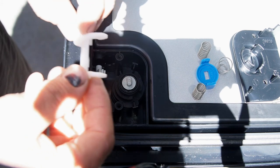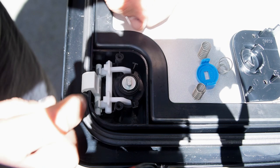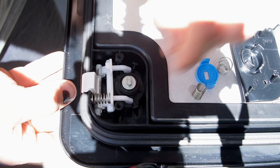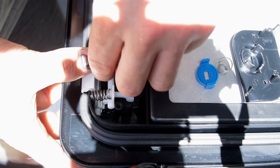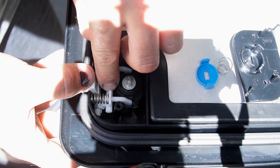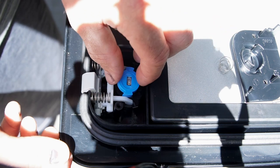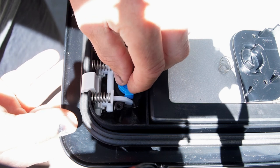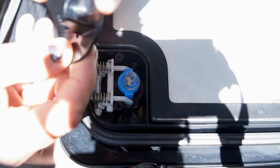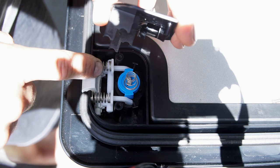The locking latch also has grooves. The springs just pop in like so — make sure they're all sitting in their grooves so when pressure pushes them down they all lock in. These grooves hold the locking latch and the latch down as well, so it's pretty foolproof.